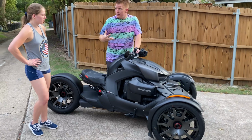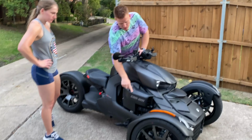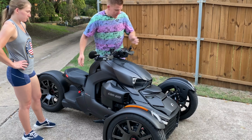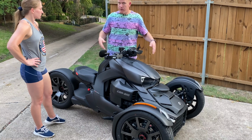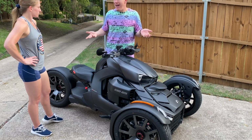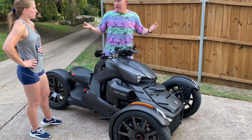But that transmission gets really hot. So it has a transmission filter on the other side of this, and it pulls in air to cool it off there. On the left-hand side is a traditional cold air intake, and you could swap that out for a Can-Am air filter, and they've dyno confirmed that to pick up about 4.5 horsepower. Not that much, but when you're dealing with a 90 horsepower platform, it could be a lot.